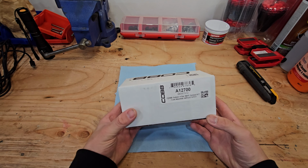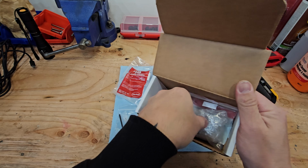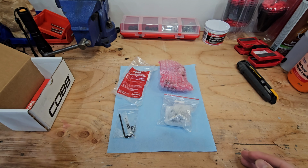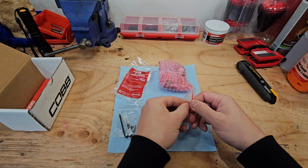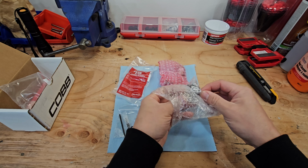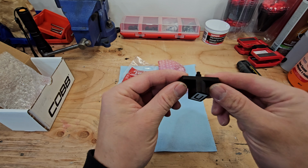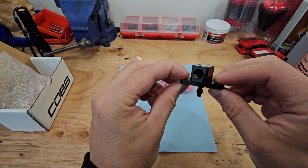All right, so this is the 4-bar MAP sensor kit. The part number there. It does say cast manifold. I'm not sure if that means they have different ones for, say, a Process West manifold, but if you've just got a stock manifold, make sure to get this one. So this is the little billet piece that we'll install in the stock location of the OE sensor.